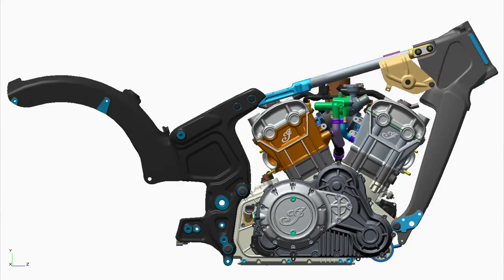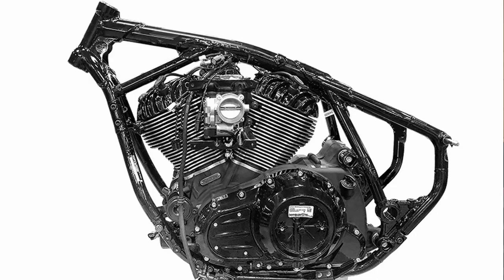But because the Chief shouldn't be in the middle of the pack — it should always be at the top of the lineup. It's literally the definition of the word. Anyway, off my soapbox. The frame itself for Indian is a departure from their typical cast aluminum frames, like on the Scout and heavyweight platforms, utilizing the engine as a structural member. This new Chief frame is very similar to the Harley design, using a traditional full-tube steel frame with the engine resting inside of it. However, the rear subframe is still cast aluminum.